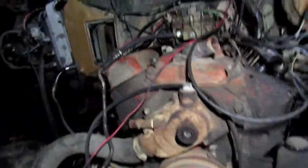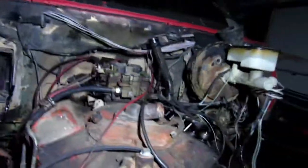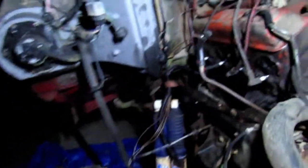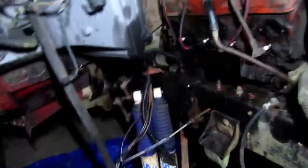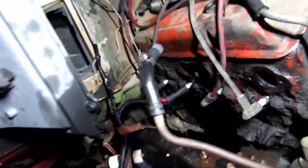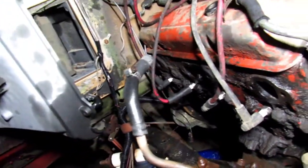Like I said earlier, we got everything on — oil pan, all that stuff, wires on, carburetor, all that good crap. Anyway, the starter was dragging so we changed the starter. We had a high torque starter and thought it would fit, but it didn't — it was hitting the bell housing and it wouldn't line up.